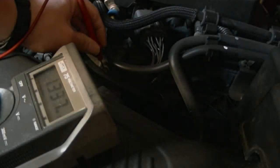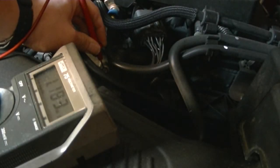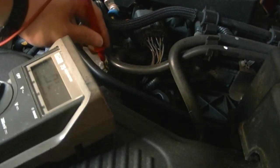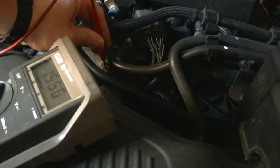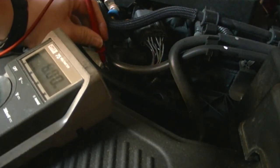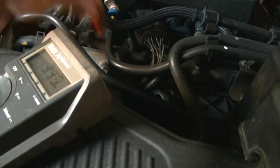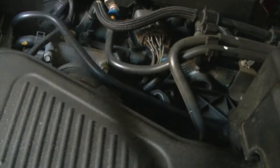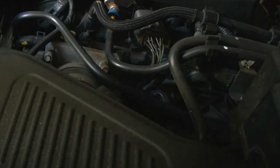After I drive, I'm just going to test again. It's not as high as 2 megaohms, but it's still 1 megaohm and dropping when connected to the chassis ground. Maybe there is some truth to this throttle body ground mod, or at least some way to debunk it. Let's wire this up and see if we notice anything.